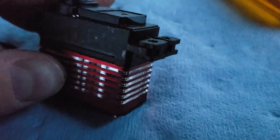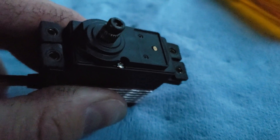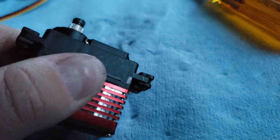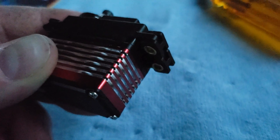If you do it right, the rubber grommets will hold on to the ears of the servo very tight — they'll give you almost no play at all, but they will still provide the necessary insulation against vibration. Super quick, easy tip. Hope it helps.